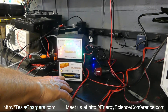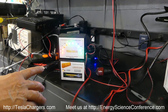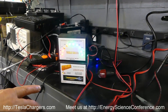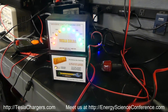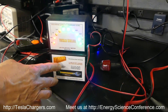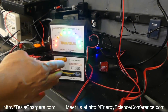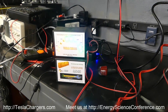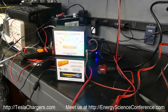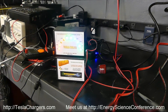The Xtreme is made for highly sulfated batteries, but one word of advice: you must make sure the battery has something in it before you use this, otherwise you'll end up boosting it. It won't start unless there's at least 6 volts on a 12-volt battery. Don't use it on 6-volt batteries — only 12-volt. You can put it on any 12-volt battery.